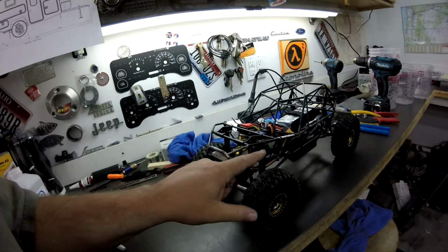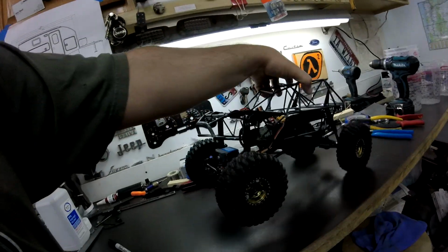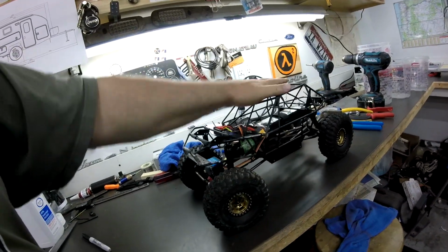So you pull one of those out, lube them up, and then it comes with 3 different spring weights. It comes with these black springs, which are the heaviest ones, and they're super stiff. Then it's got silver springs, which are the medium, and then the gold springs are the light. So I put the lightest springs in, and not even close to enough tension. The thing just basically dropped all the way down onto the bump stops, or bottomed out essentially. So then I ran the medium ones, and kind of tested it a little bit, and the thing was basically extended all the way up. It didn't have any sag.